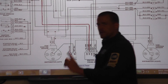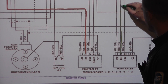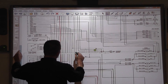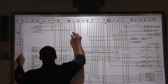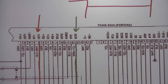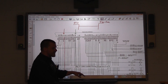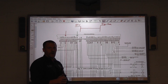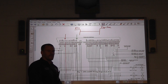What we're going to do while we're here is map out the other IGT circuit as well, because we're going to do them both on the car. We'll map out the other IGT on the other igniter — it's pin 2 and it also goes to the computer. There's the IGT2 signal. What we're going to try to determine is circuit design on the car using a voltmeter. We want to know: are the igniters sending voltage to the ECU and the ECU is pulling it to ground to make the square wave, or is the ECU generating a square wave and sending it to the igniter in a pull-up fashion?